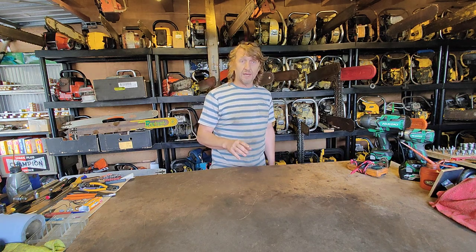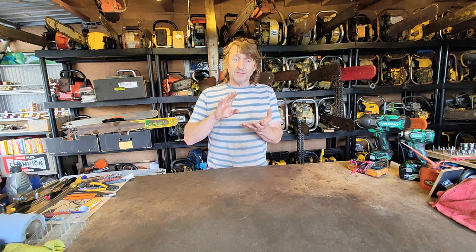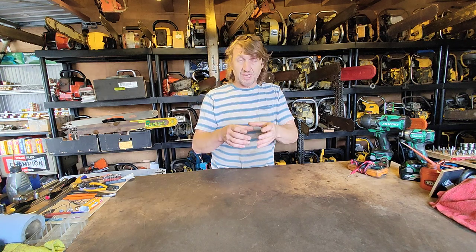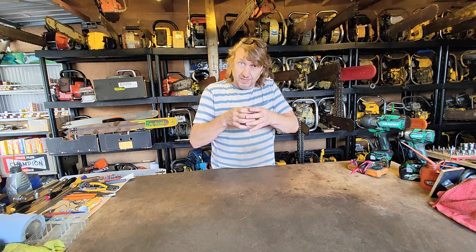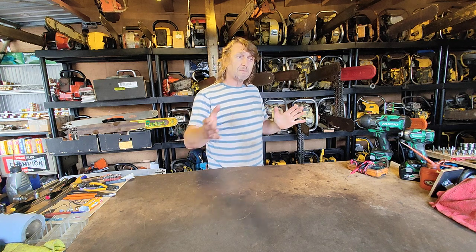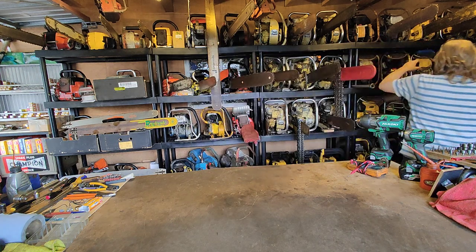So I'm going to pull out one of my saws, and this saw is the McCulloch 172, an early 60s saw. It has been stood, as far as I was told, for over 30 years. It has been pulled over with good, or definitely reasonable, compression. What you tend to find on old engines, I certainly find that on a load of my beautiful old Clintons, is that if they've been sat stationary for 25, 30 years, maybe longer or less, the piston rings, as a lot of you will know, will stick in the grooves on the piston, and then they just perhaps won't develop compression until they've freed off. So that girl, the 172, I did the video maybe two weeks ago. When I brought her in from outside, she's then sat up on the shelf, and has not been touched since. So we're going to take her as a working example, and we're going to kill a few birds with one stone, so to speak.